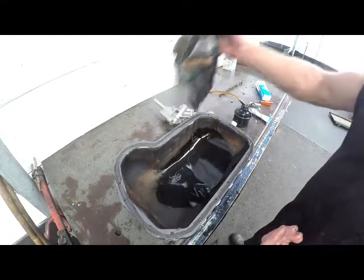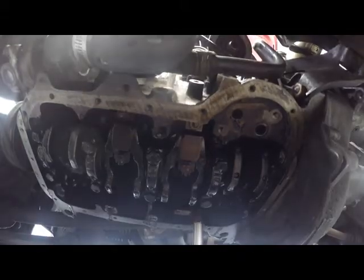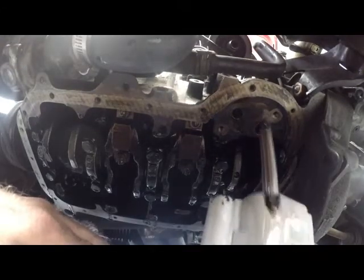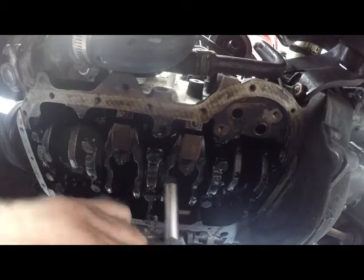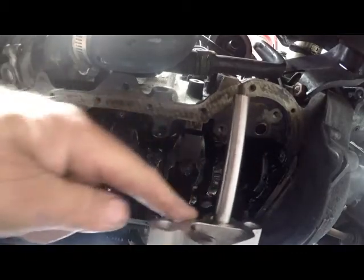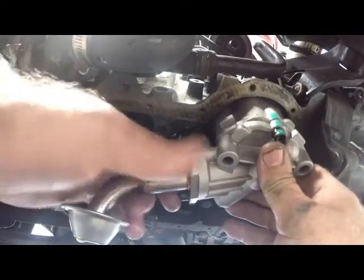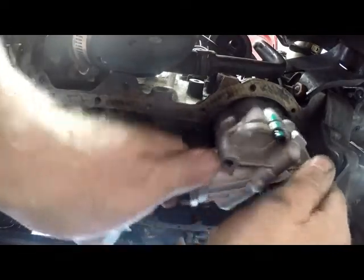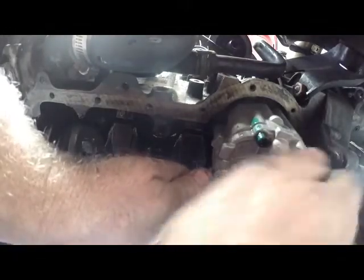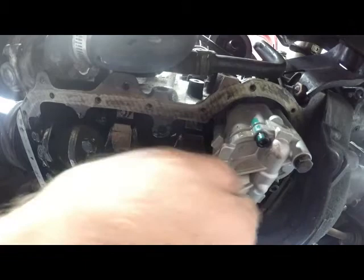We've got to fit the pump first. I'm ready to fit the oil pump — it's all nicely primed. There's no gasket used between the pump and the surface; it's basically what we call a flush fit. So we put your input shaft through — it's got a little lug on it and it will basically go into the distributor, which is geared to one of the shafts. That in turn will turn the oil pump gear to activate the impeller to pump oil through the engine.